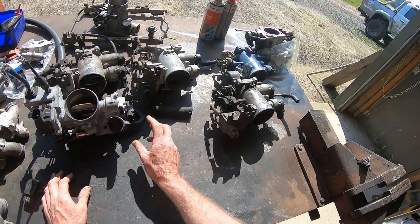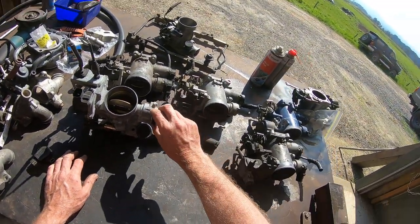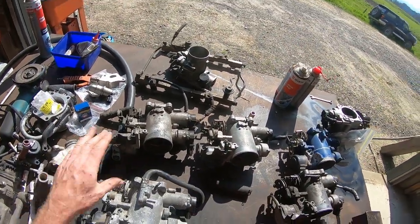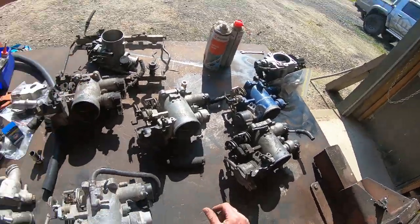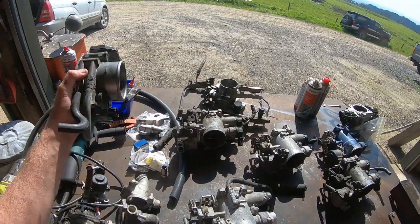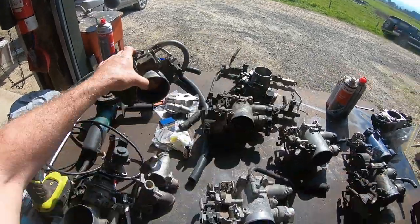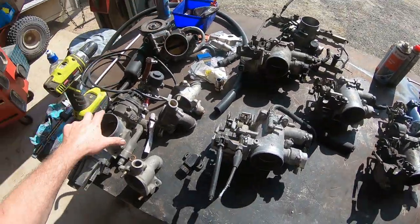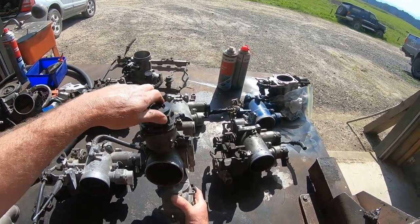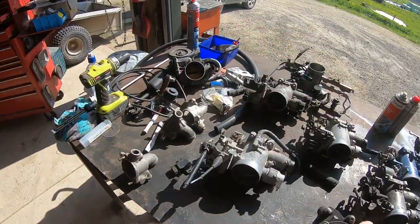In the TPS's they do have different keying between the sub TPS on the traction control and the main TPS. I've also got just as a reference the VVTi 3UZ full drive-by-wire - no cable at all - and the VVTi 1UZ which has got the accelerator position sensor on the side of the throttle body, yet it is still drive-by-wire. I've done a different video on that one.